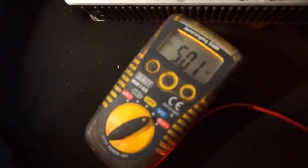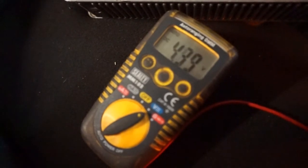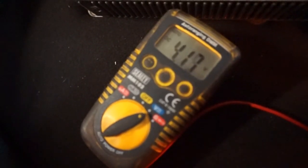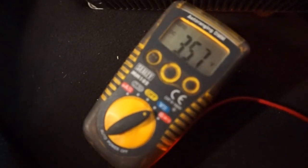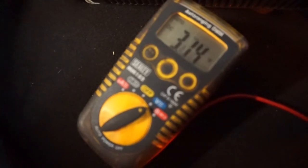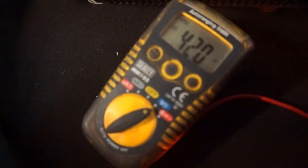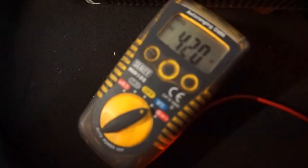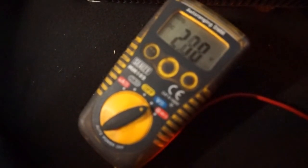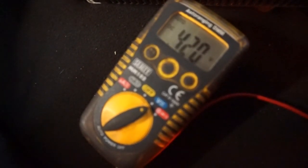I've got 5 volts at no throttle, so that should be correct for a two wheel drive setup. As I start to put a wee bit of throttle on it should start pulling it down - and it does pull it down, down, down the more throttle you apply. But what I was finding is that once you go into full throttle it pulls it back up, which is like what we were getting on the dyno - because once I was going into full throttle it would misfire. If we did a run at like half throttle it would do a pull but only make about two and a half hundred horsepower, and then as soon as it was going into full throttle it was just causing a misfire.